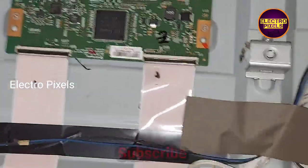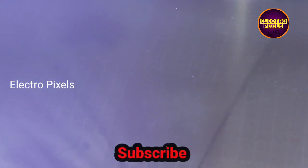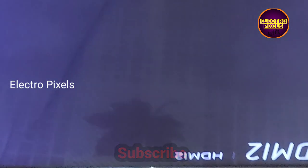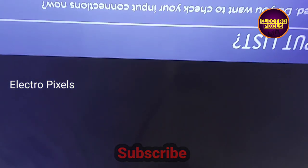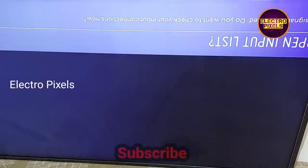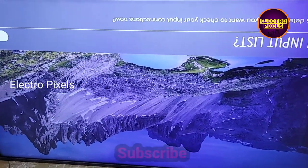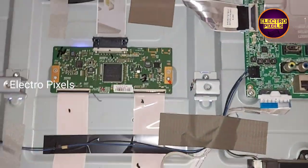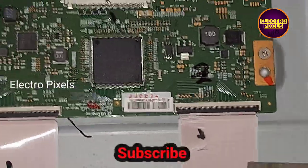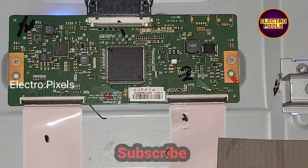The TV is now turned on. The picture comes up — here you can see the final result. There is no flickering or double image. The complaint is solved successfully. The display is perfectly okay. The TV is repaired successfully. We confirmed that the issue was with the right side of the panel, and we blocked the gate signals from the right side. The double image and flickering issue is now solved.